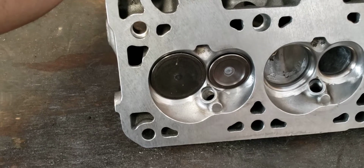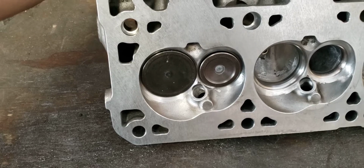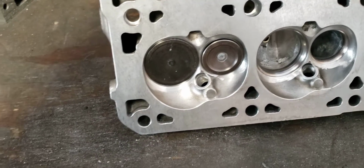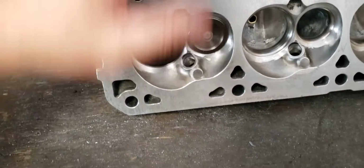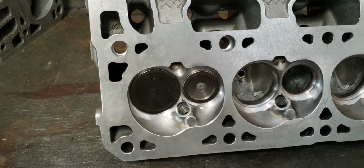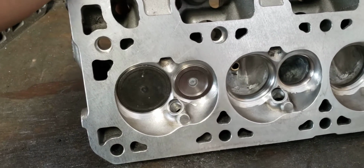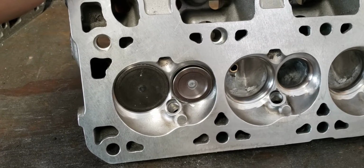So what I'm trying to do is maximize that low lift exhaust flow. Twofold. One, on our exhaust stroke, so we've gone through compression, intake, and exhaust valve are closed. Compression, bang, sends the piston down, motivates the motor. Now the exhaust valve starts to open.